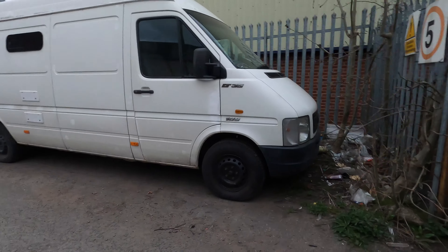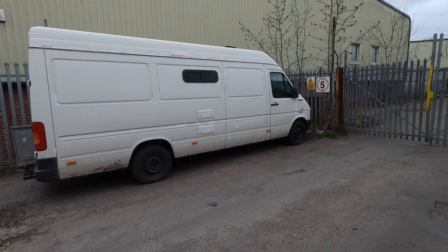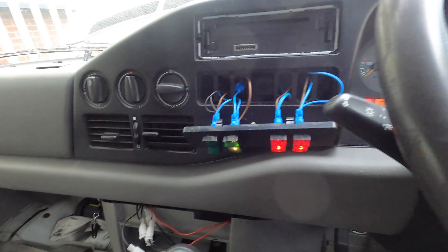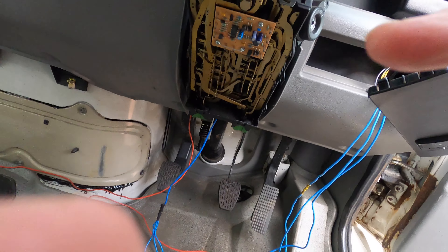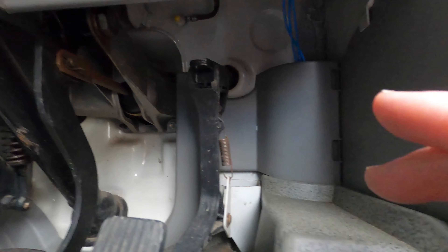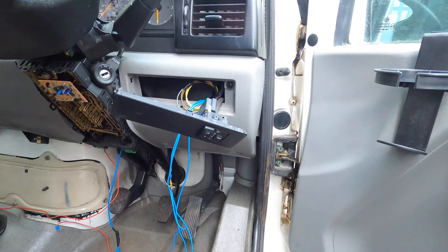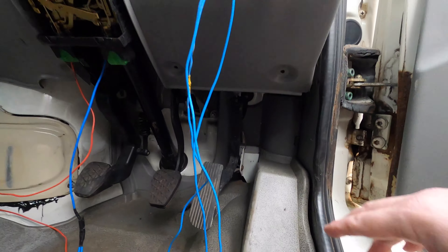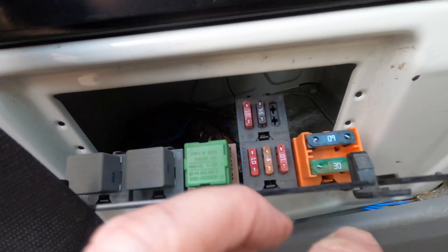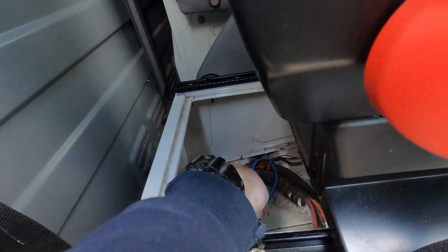Welcome back. I've been working on the Volkswagen LT35 camper, trying to figure out what some mystery switches installed by the previous owner actually operate. After a bit of investigation I managed to find another nut which held the fuse board on, which meant I could see behind it a little bit better. Whilst on my hands and knees I spotted some suspiciously familiar blue wires through a gap in some trim. I removed the panel that houses the fog light switch, followed the wiring down the trim and under the carpet to underneath the driver's seat, where behind a switchboard panel with more fuses and relays I found the ends of the wiring.